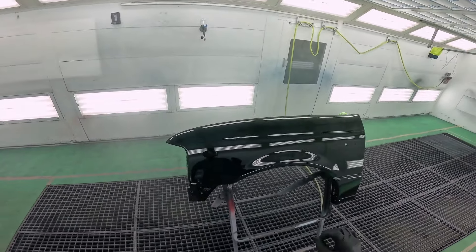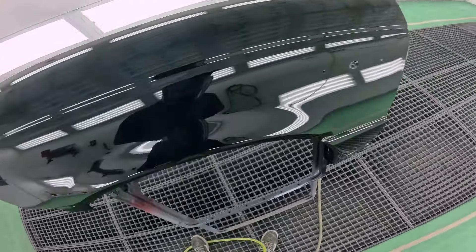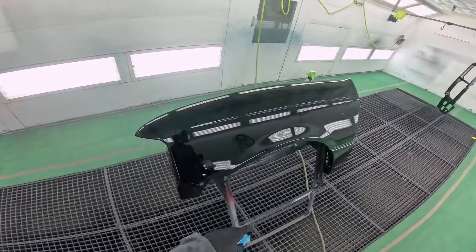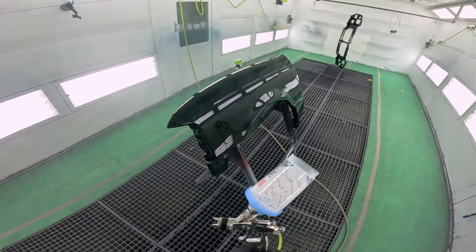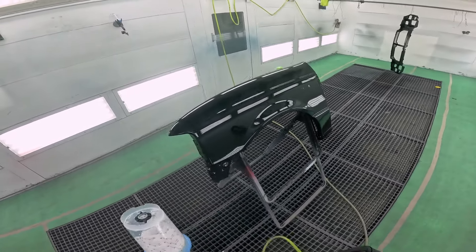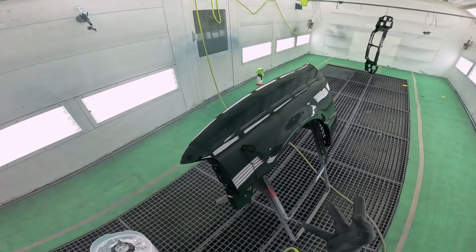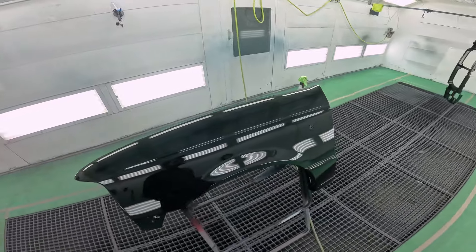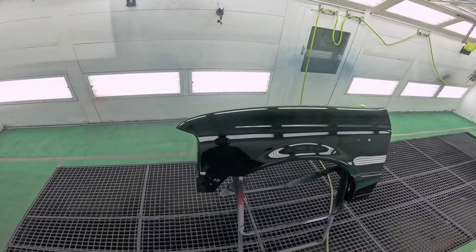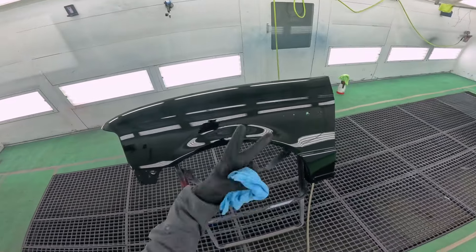This is a Ford product so I do need to leave a little bit of texture in it, but not what you're currently seeing — it's got a little bit of orange peel. The way you can fix that is I'm not going to change literally anything on the gun. I'm going to leave it the same setting — wide open, wide open, 28 — and I'm just going to back up slightly, use a tighter overlap, and really let it all melt together. That first coat I usually spray pretty quick and keep it moving, then the second coat is where I really worry about how it's going to look.